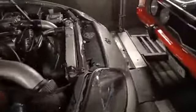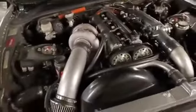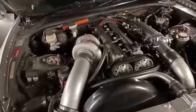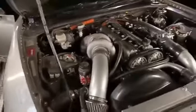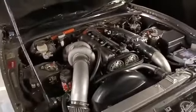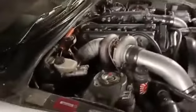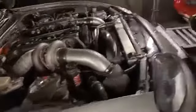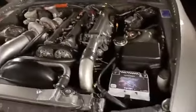This car had a fairly large turbo, so it was actually quite powerful as it was. The complaint was that it lacks low down torque. It's the sort of thing you would get with a Precision, I believe it's a 67 or 68, so it is quite large. It really didn't do much until 4,500, but once you got there and it came on boost, it performed quite well and lively, as you'd expect.